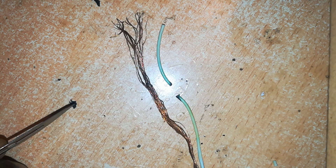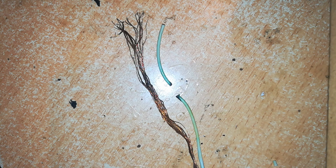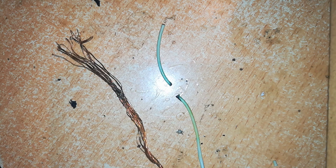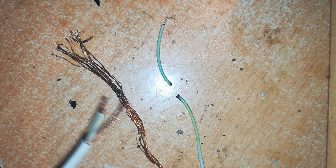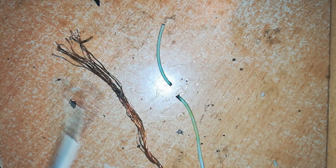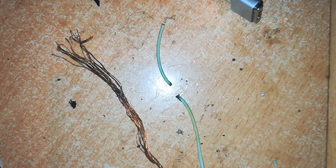This is one of the things to look for when you want to repair them. Of course, the MacBook is intelligent — it will cut off the power when there is a short — but this is still not acceptable. That's why you're not able to have power at the connector end. Once this is resolved, as you can see, the cable is working fine. That's how you repair these replacement cables, though the advice is to use a new original cable. Thanks for watching — I appreciate your time. If you like this content, please consider subscribing, liking, and sharing, and watch other videos in the channel.